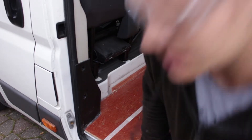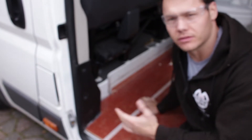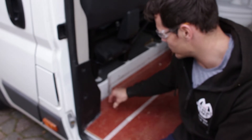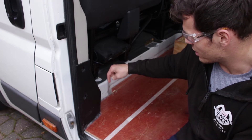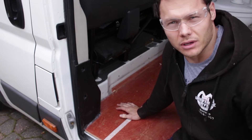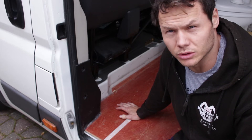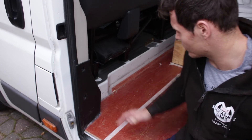My 11 kilo gas tank is going to sit right here so I can open the door and fill up at the petrol station with ease, without having to cut a hole inside the van. I need to put a little vent in the floor because gas is heavier than air — if there's a leak around the tank, the gas will just drop straight out through the hole instead of filling the van. I got that from the Van Dog Traveler — thank you for putting the whole PDF of your van build online.